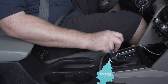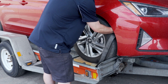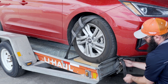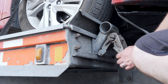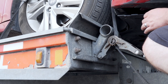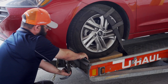Before exiting the vehicle, be sure to place the vehicle in park and engage the parking brake. Position the straps up and over the front tires, making sure they are centered over the tire. Move each strap ratchet left or right to align it with the center of the tire. Route the strap through the slot on the ratchet spool, making sure at least 6 inches of the strap passes through the spool. Tighten the ratchet, folding the handle down when done, then repeat on the other side.